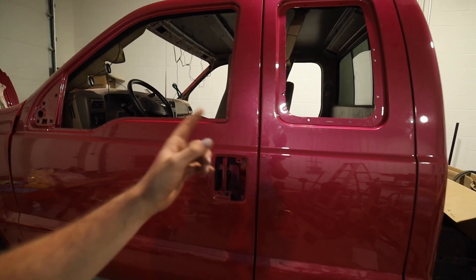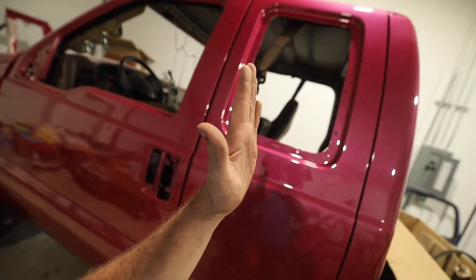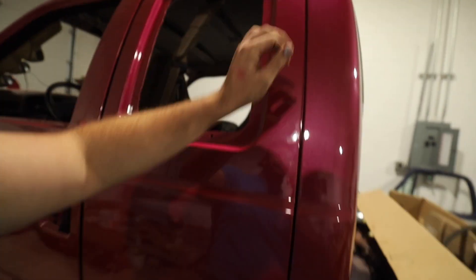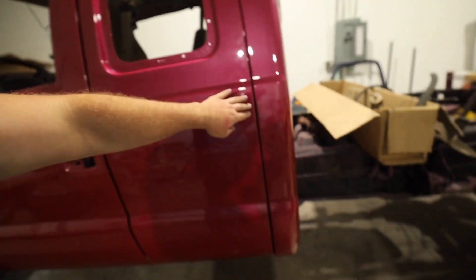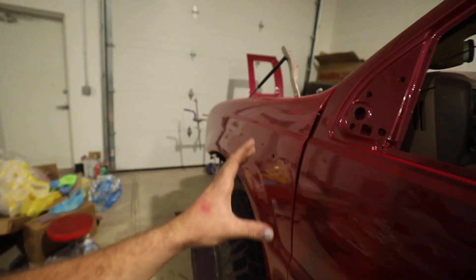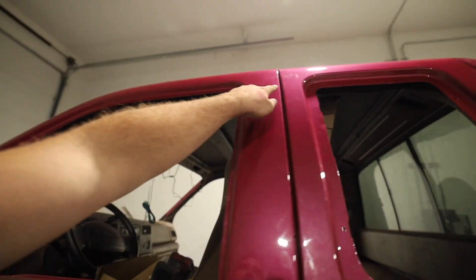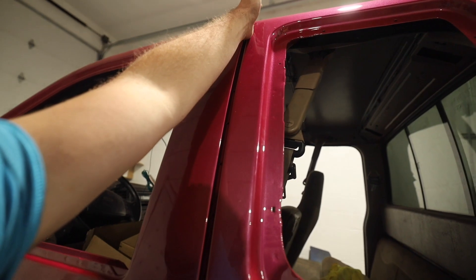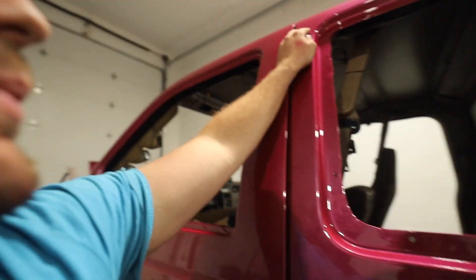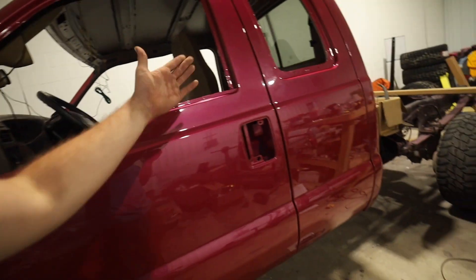So a quick rundown inside the door here. There's three bolts inside of each of the extended cab doors. That's going to adjust your up and down, really the tilt of the door. You can slide them in and out. This gap was huge when we started. Loosen the bottom, kicked it out, took the top, kicked it in, and it gave us this beautiful body line. Up there we have an equal gap all the way up. The hinges are obviously bolted to the truck, so the only adjustment you really have is in and out. At the beginning this was kicked way out. Don't forget there's a huge weather stripping piece that goes here and overlays the door. So this door was like this much out - loosen the bottom, kicked it out, loosen the top, kicked it in. And now look at these body lines.